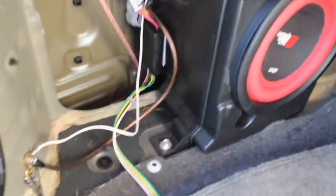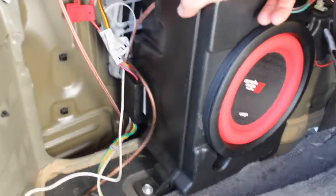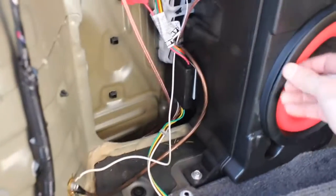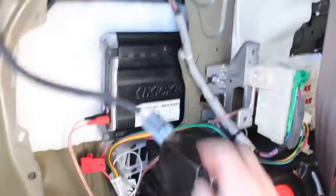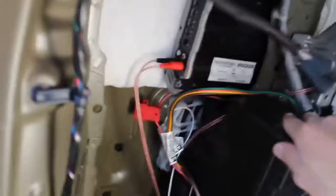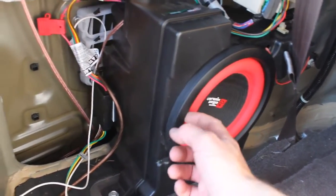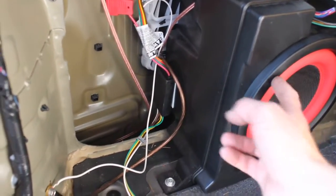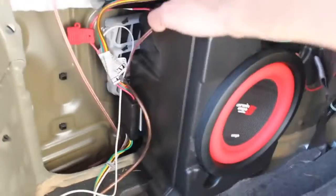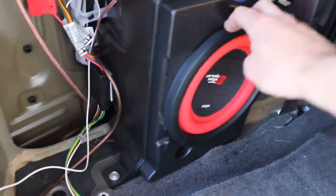Don't get me wrong — this box is not the correct volume for this sub, probably. So you're not going to get that perfect bass that you would get if this was in a correctly sized box enclosure. This amp is a Kicker DXA250.1, a mono 250 watt at 2 ohm. This is a dual voice coil Cerwin Vega sub, 250 watt RMS, and it's a dual 4 ohm. So I hooked it up, wired it to 2 ohm and wired it straight to the amp. Stuff wasn't too expensive because it's relatively low wattage compared to some of the stuff out there.